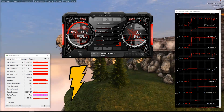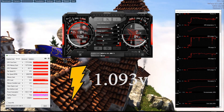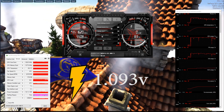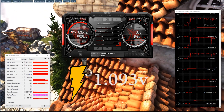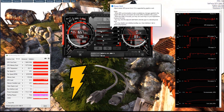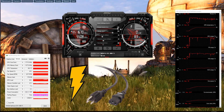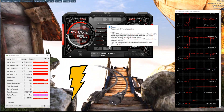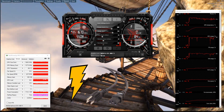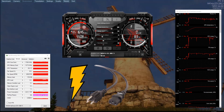For starters, there is a limit of voltage. The core voltage limit is 1.093V, so no video card can pass this without hard modifications — that's pretty much the only way around it. Second is the power limit, which most cards go to 120%, which is about 300 watts total that the video card can pull. Some higher-end custom cards can do 130%, which is about 330 watts.